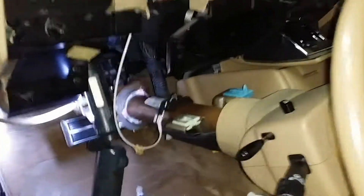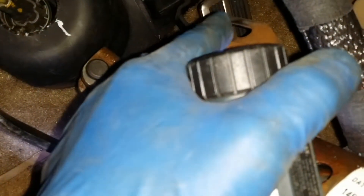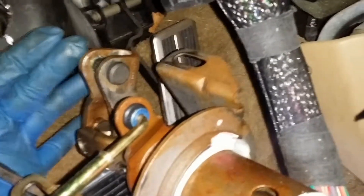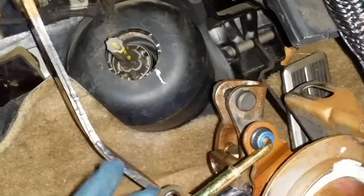Here's the steering column — there are two of the mounting locations for it and the other two are located down in here. This is the steering column assembly and I'm going to attempt to put that back on. There are four bolts that hold it on — one, two, three, and four. The other thing you need to do is attach it to the spline which is right in there, so I'm going to have to slide this over that probably before I attach the two bolts.